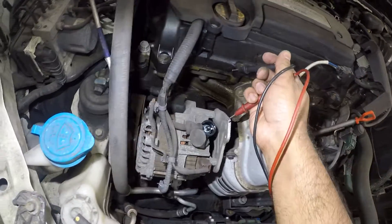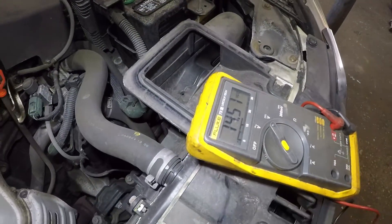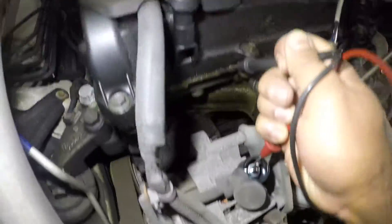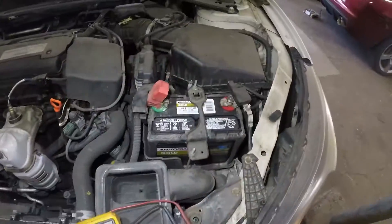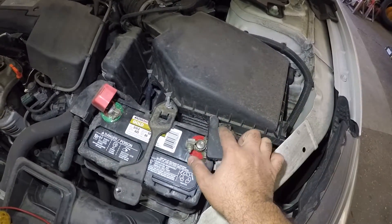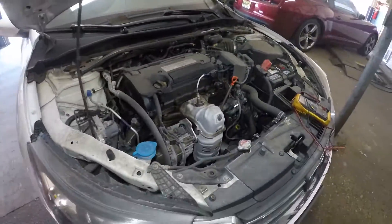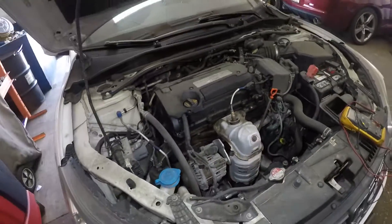You can also put the negative right here on the engine block. You see that — 14.51 into the block, negative right there, positive here. So do a couple of checkpoints. This car has a battery sense connector — sometimes this comes off, so make sure you push it back. I had one car where I had to put a zip tie because the connector kept coming loose. Anyway, there you have it — thank you for watching, don't forget to subscribe, and don't forget to push this back once you're done!